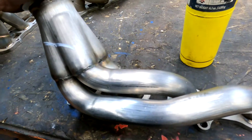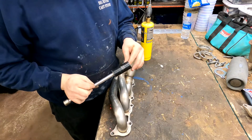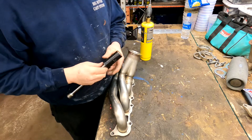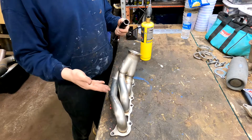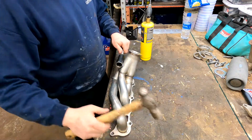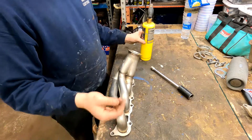I'm going to put it on the tripod and we'll see what we can get done with this map gas. I got an impact socket here — a 15/16 Harbor Freight special on an extension. All I'm going to do is use the map gas to get this line that I have scribed. It needs to be red hot, and with it being stainless it really needs to be hot enough. Then I'm going to come in, lay the socket on there, and hit it in as best I can.